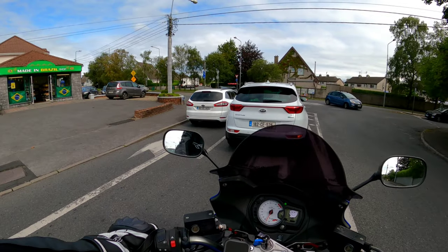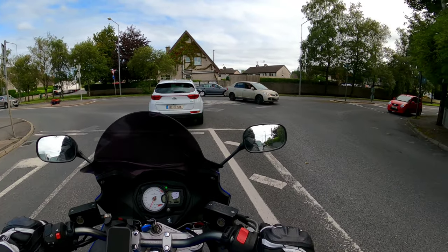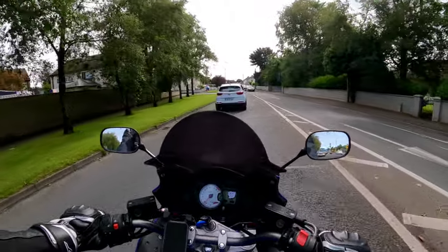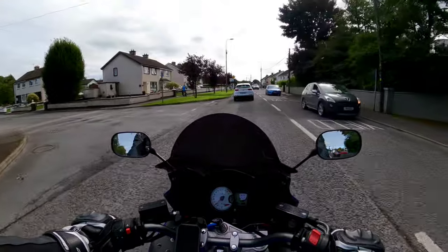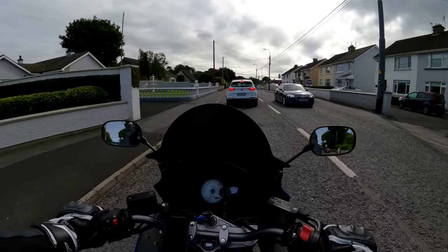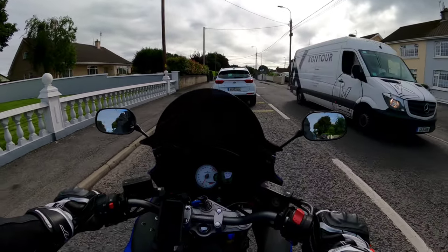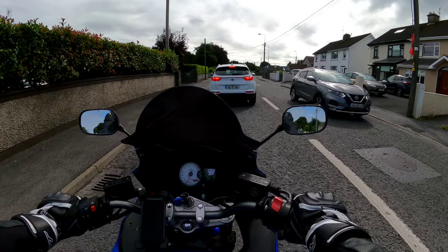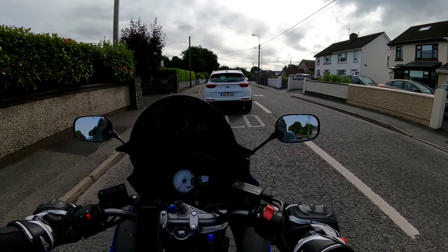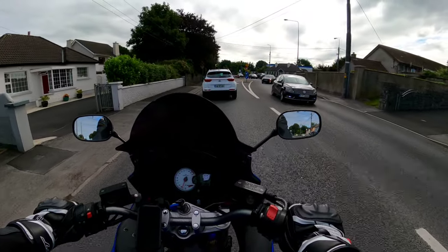So I cooked them up, took them out, gave them another sand. I put them back on, made sure to clear out all the excess brake cleaner and brake fluid. Another thing I was careful to do — I nearly forgot — I wiped down the brake disc as well, hit that with brake cleaner and tissue. The amount of contamination, just slippery black stuff that came off the disc, was carnage. So it was a good idea to remember.